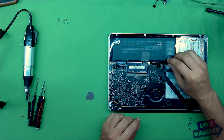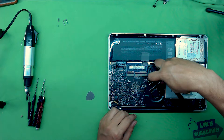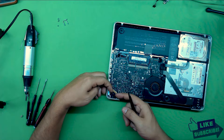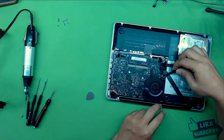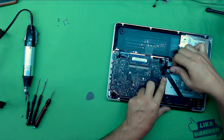Grab your tweezers, pull the ribbon cable for the keyboard out. Remove the hard drive ribbon, remove the CD-ROM ribbon, the Wi-Fi, and the webcam cable, and the cable for the LCD panel. Lift the hinge and pull it out with two fingers towards one corner — don't pull the cable. Once you do that, remove the fan. The fan just pulls out towards the ceiling, don't pull it to one side. Same thing with the speakers and audio cables — pull straight out. The last one you have to pull to one side.